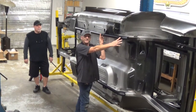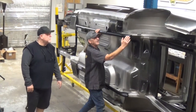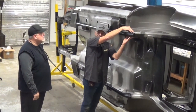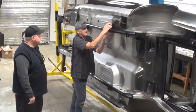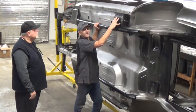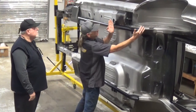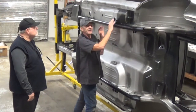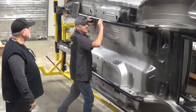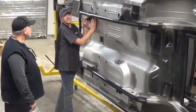Same with this rear. The rear of the tube is bent in conjunction with the subframe. It seats right along it, and it's a plate welded on each side so that we can weld the subframe connector to the sides of the subframe, and then another point up front directly to the torque box, which is the strengthening part of this particular vehicle with the subframes. So it gives us that 2 feet of extra added strength in this subframe connector on both ends, rather than a tube notched through the floor pan to the torque box and the end of the subframe.